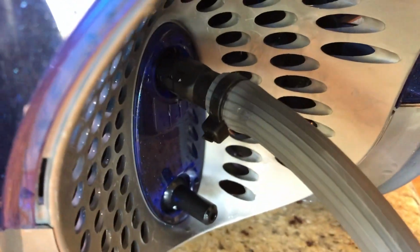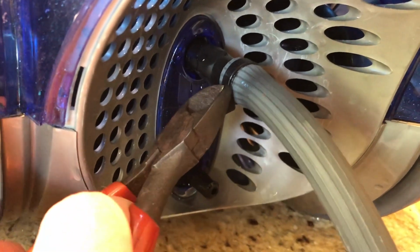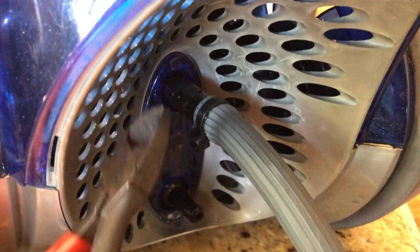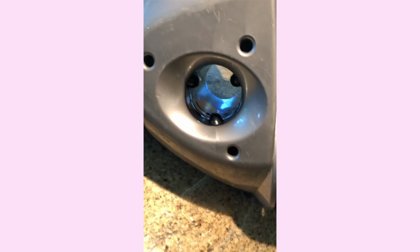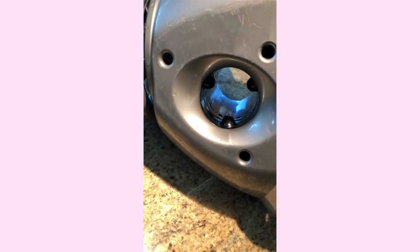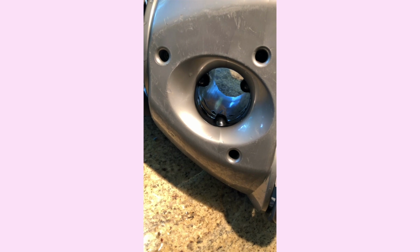So anyway, I got to cut that thing off of there, and then pull the hose off. The hose is attached to the water unit. It's attached right there to that constraint valve that we're talking about that affects us. Water management, we got the hose off. We'll get the water management. We got to pull these 3 screws here, here, here. They're all the same size. There'll be 3 more screws inside that pull the water management unit loose, and so we'll get these 3 out.